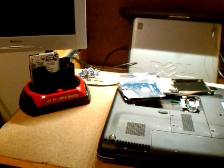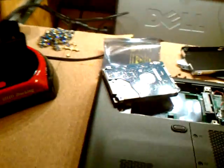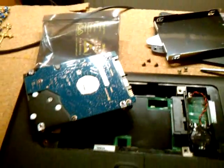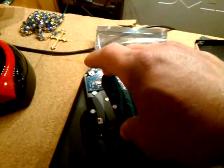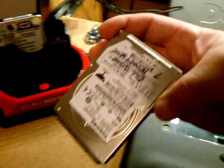Some people have different ways of doing it. I don't like using software CDs for cloning or any other program. What I do is pull out my hard drive — which I've done here. I pulled it out of the laptop and out of the tray, that way I don't spend so much time on this video. This is a 250-gig hard drive, and the one that's in there is a 200. This is where the mother disc goes, which is the one I am cloning from.